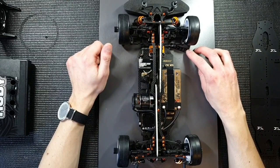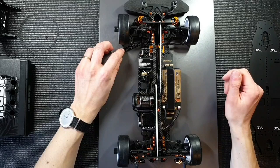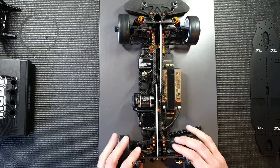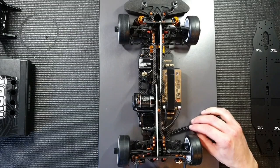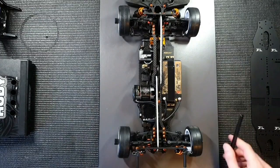Here it's 5.2 - it needs to come up a little because I want it to be 5.5. You should just gently slide it underneath the chassis, and it stops right there, so that means it's 5. At the rear, it's almost 5.6 - it's too high, so we need to lower it. Same process here. I tried to loosen the preload by the same amount on both sides. That's done - 5.2, right where I want it to be. Check the front again so it's not out of level. Ride height is checked.